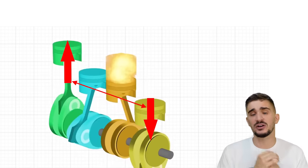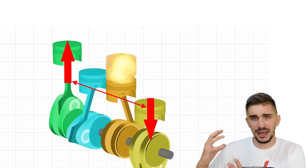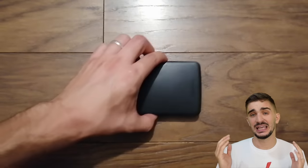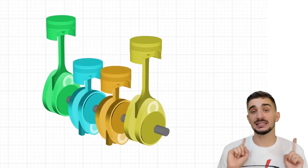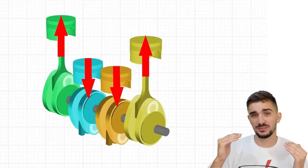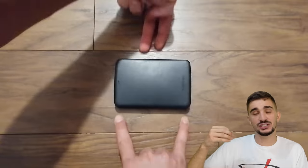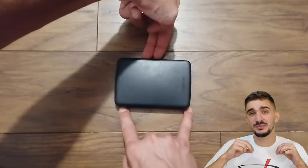So our two pistons are in fact a rocking couple, and the effects of a rocking couple on any mass can easily be observed with any simple object. If you apply equal but opposing forces at the ends, the object will rotate. The flat plane inline four has no rocking couple because the forces applied at its ends and at its middle are both equal in direction and equal in magnitude, and thus the flat plane inline four is perfectly balanced in relation to its center of mass.